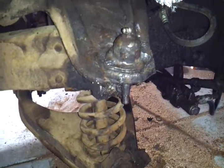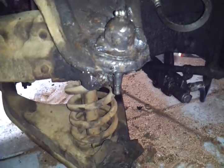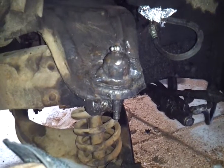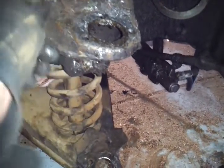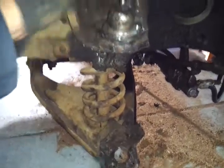On this '57 I know that it is riveted, and there are some pretty tough rivets. The kit I have tells me to make the holes 3/8ths, so I drilled it out with 3/8ths. You can drill pretty much to the thickness of the base of your ball joint, and once you get to your upper control arm you can continue to drill. But since you're going to have rivets in here, it's best to take a punch and punch them out while the shackle is still installed — drill down to that thickness and then punch it right out.